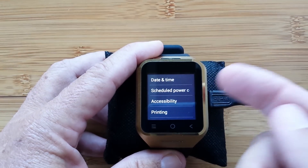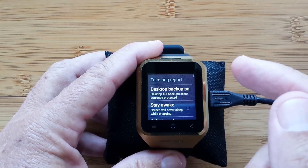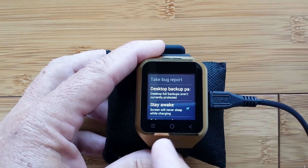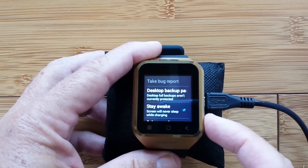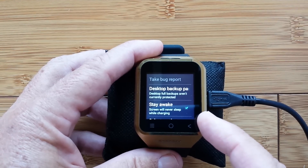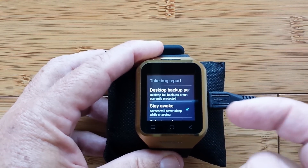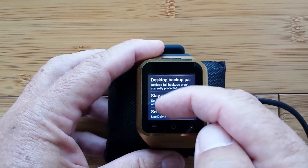Date and time we'll set off camera. What we want to go into is developer options. There are two things in here you're going to want to play with. First one is 'stay awake' — it will never sleep while charging. A word of warning: you want to make sure you're plugged in and charged, and critically, check the phone to make sure it's not too hot. It gets really, really warm — excessively warm. I actually unplug it and put it in the freezer for a minute or two to cool it down periodically when doing massive app installation. Check stay awake, but monitor the temperature by physically feeling the phone. You don't want to get to the point where it actually shuts down on you.